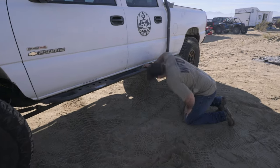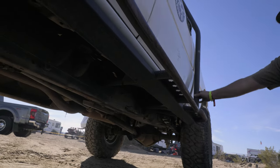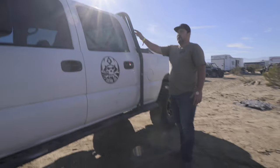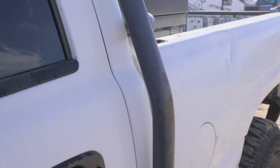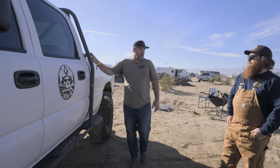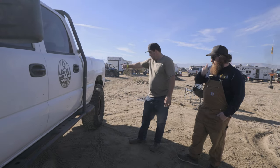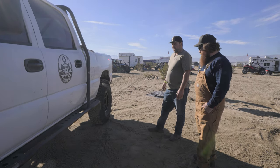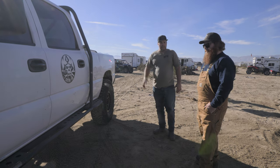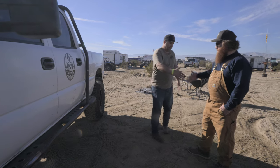The rock sliders are frame-mounted, fully gusseted, welded to the frame — built in-house using two-by-four tubing with 3/16-inch wall underneath. He also did a headache rack with a mild roll cage treatment. You can see it's been used. In the event of an actual cartwheel, it'll protect you pretty well. It's fun to come 500 miles through the desert and come across guys who built sweet trucks and are actually using them for what they should be used for.